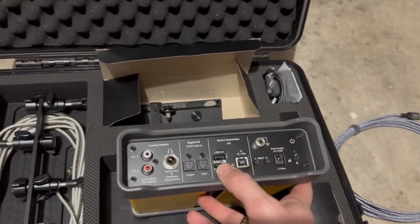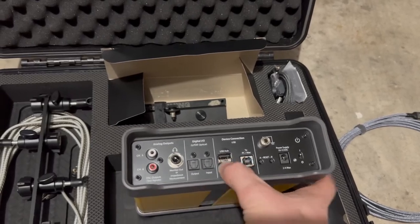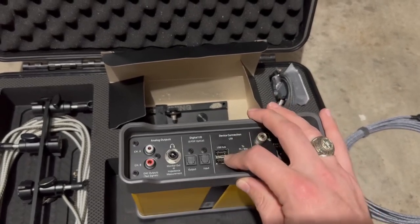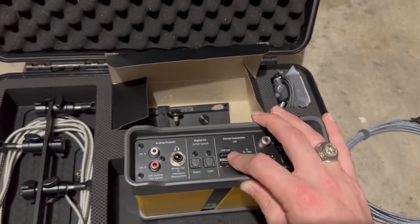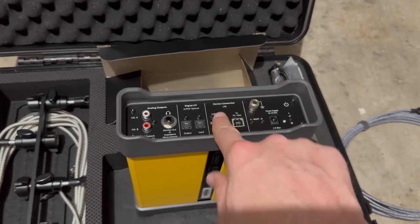If you are running JL Audio VXI amplifiers, you would plug them into the USB hub area — this is how we're going to interface our JL Audio amplifiers. Specifically, if you're running Helix, Moscone, or ARC, you are not going to use this section.